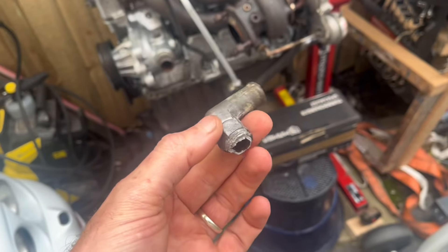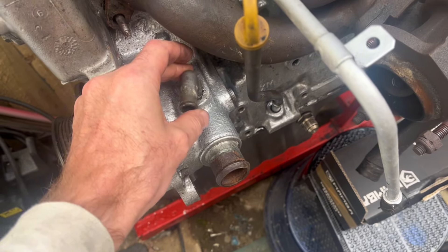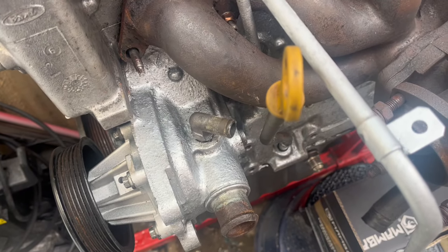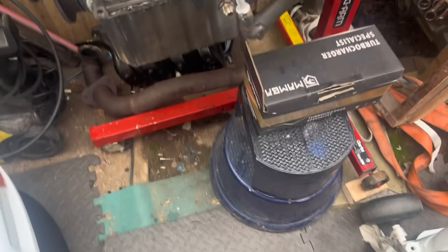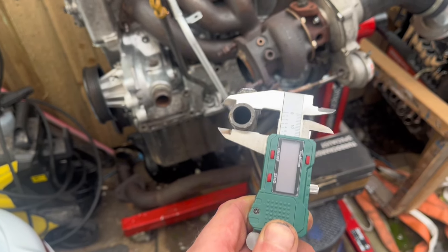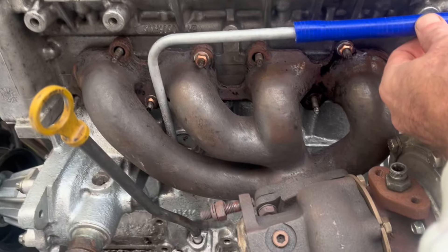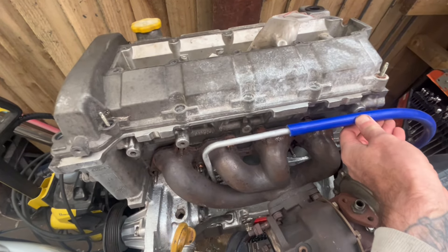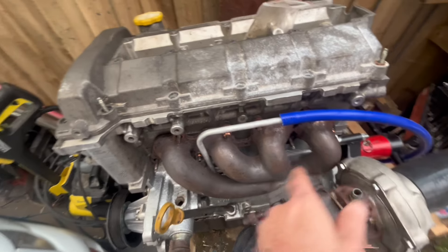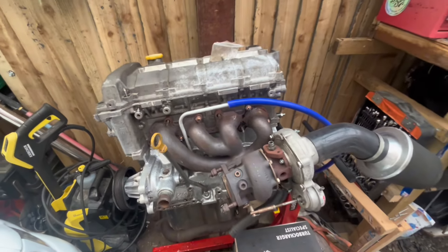So this is the snapped feed - it would have run this way which was no good near the manifold. It's going to have to run off this way, or I could run it around here and put some foil tape on it for heat protection. This is 16mm outside diameter on the water line, so I need a 16mm inside. I've cut that pipe and I'm going to put a loop there. I think I'm going to run the MPT adapter up here, link two of them together up here - there will be heat I understand that - but it'll be wrapped with some foil lining.